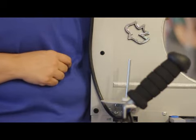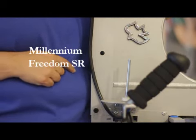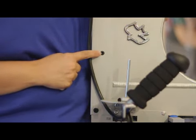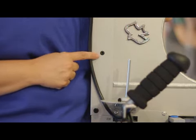For 2008 and newer machines, including the Millennium, the Stitch-Regulated Freedom, the Lenny, the Lucy, and the new George built in 2010, our needle positioner adjustment location is on the back end of the machine, right above where your right handle is. There's a small black plastic cap in the back end of the machine. We pop that little cap out and you'll see there is a grommet protecting the back cover. Your adjustment screw for your needle position is right inside that front cover, and you'll need a small flat blade screwdriver to turn the screw.